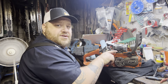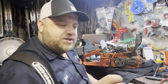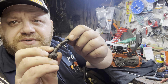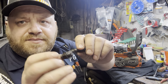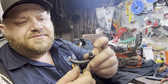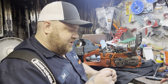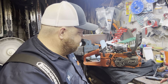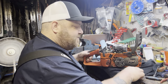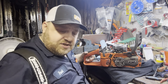See it right there? Originally it looks like this — this little thing goes right into the port of the transfer, and this screws right in where your decompression valve does. It's automatic, and they were problematic. Not a good idea, Husky. We're going to fix that.